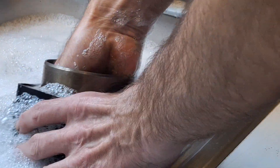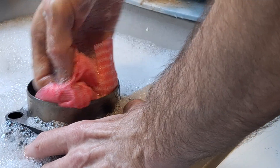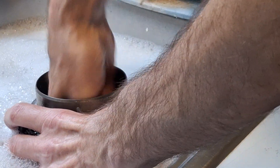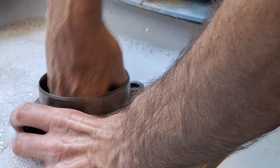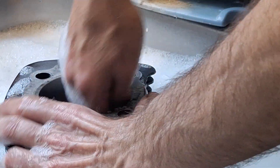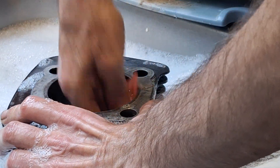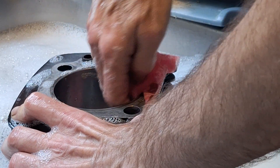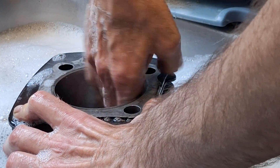So we're just going to scrub them. You'll want to oil these as soon as you take them out. We'll give them a good rinse and then oil them down. Then we'll scrub them out again with oil to make sure that we don't have any swarf remaining in the cylinder.